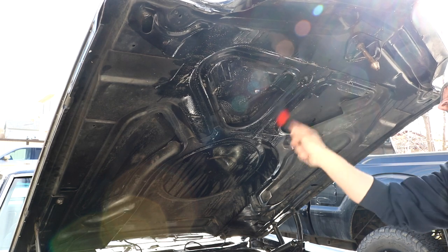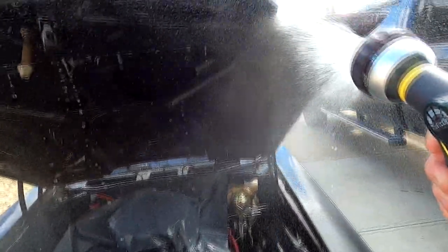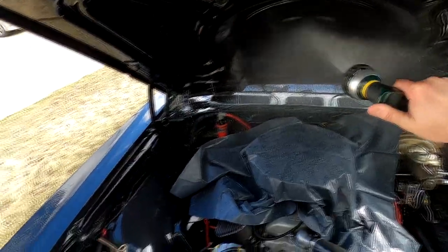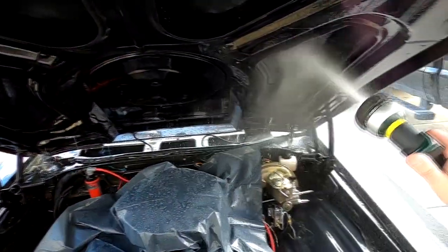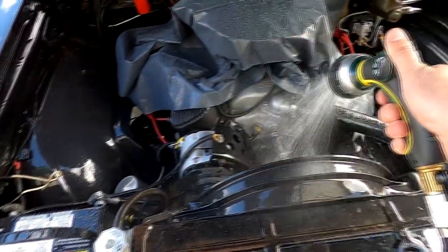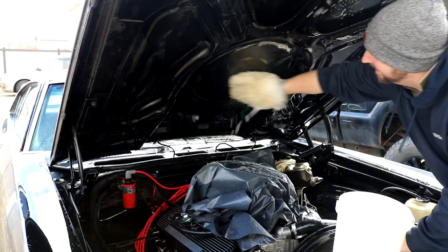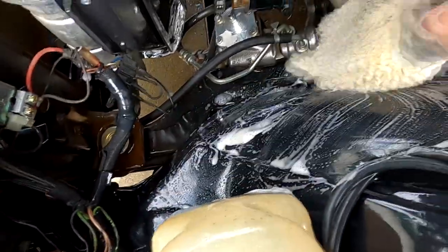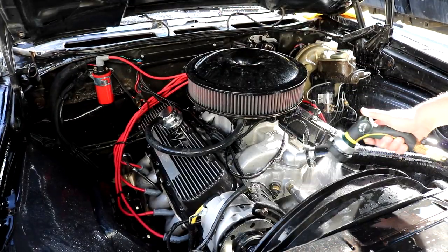After scrubbing it down, I gave the engine bay a rinse using my FitLife garden hose. A review I did of the hose can be found in the description. I covered the air cleaner with a plastic garbage bag as I didn't want any water to get into the engine. I recommend cleaning the underside of the hood first, otherwise all the dirty water will drip all over your clean engine. I then used soapy water to go over the engine bay a second time. Another rinse with the hose, and then I dried it off with a microfiber towel and compressed air.